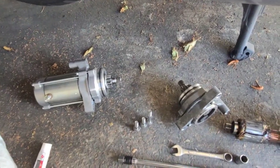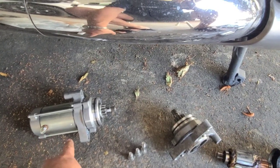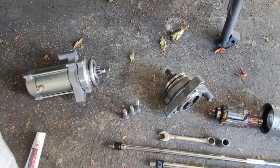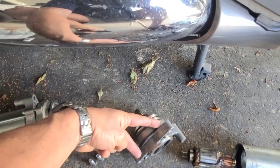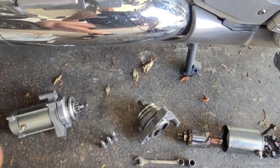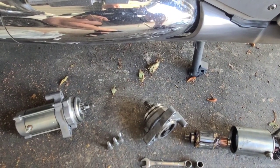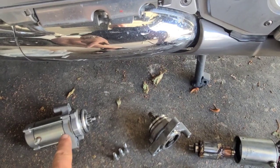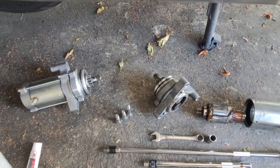So I did put this one in — I connected power from the battery to the terminal and to the ground, and the motor spun. But what I read on the internet is that when you put it in, do not tighten it with the two screws going through those holes. As I was doing it, I heard a clack and then it went inside — I got really scared because people on the internet were saying there's a chance I broke something inside the engine. So I took it out again, stuck my borescope at the hole, and I didn't see anything wrong.